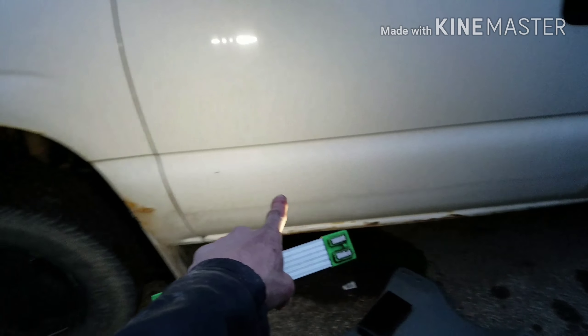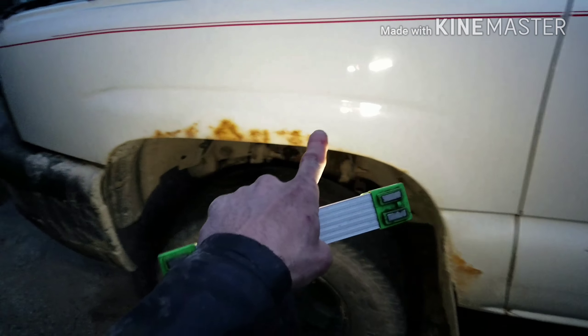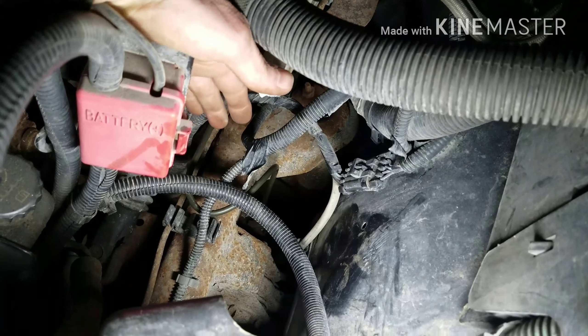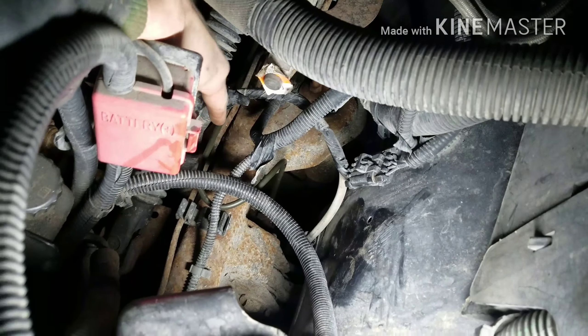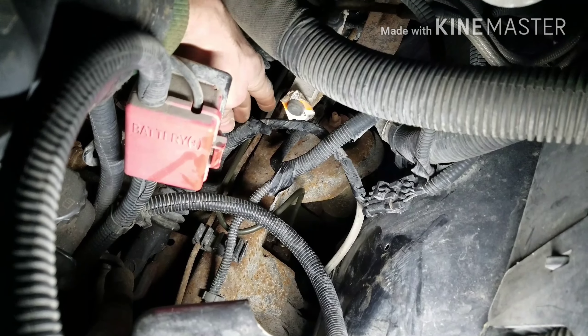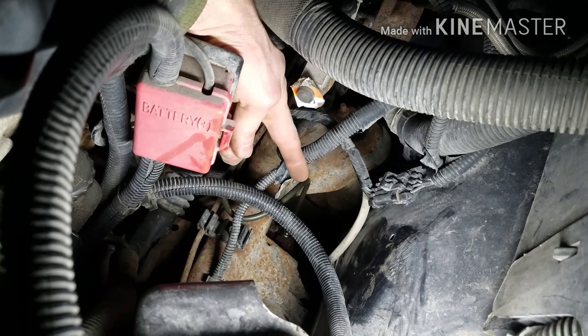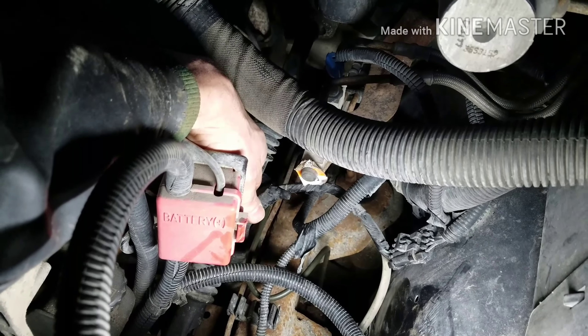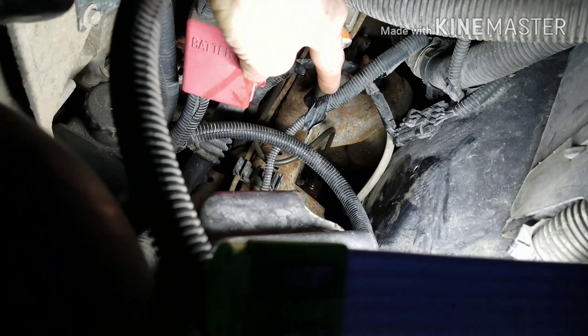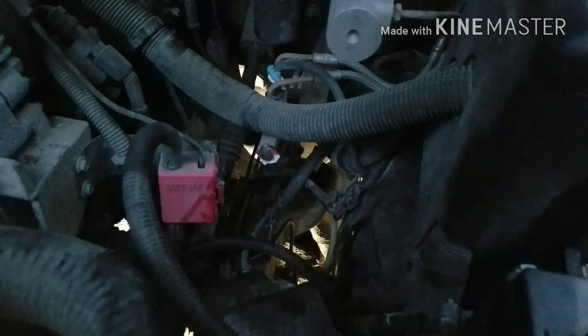I've got the brake line ran from under here by the ABS, attached it there, ran it up on top of the frame, and ran it along the top of the frame up here. Here's the new brake line — you can see the greenish line right here. It was a little longer than it was supposed to be, but I don't have a flare kit and most other people don't either, so I just brought it up here, bent it around and down. Now I'm going to bleed the brakes and make sure everything works good, then I'll fasten everything down. This is a quarter-inch line so it's pretty tough.